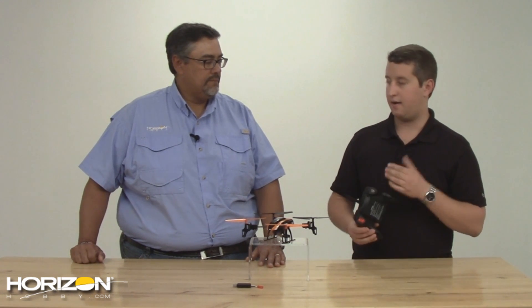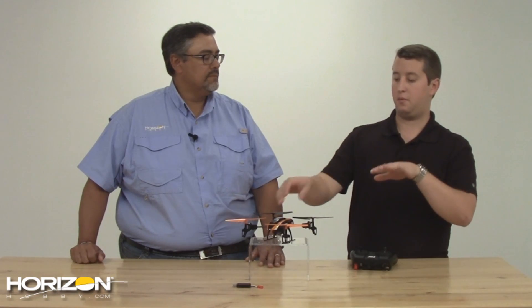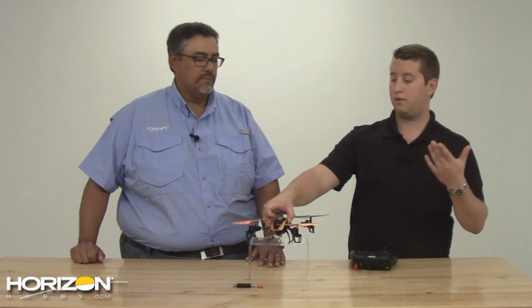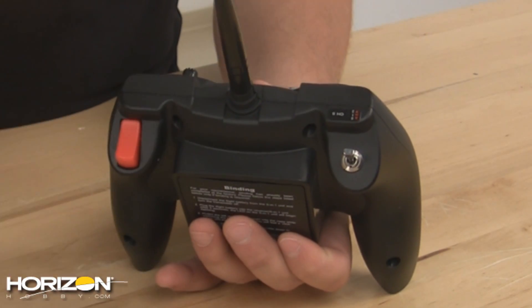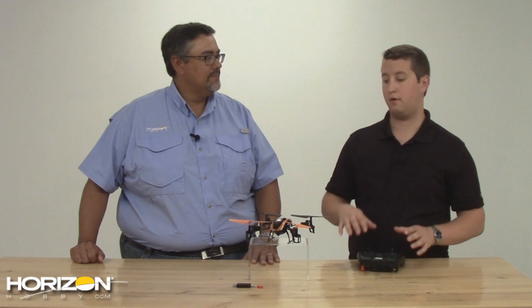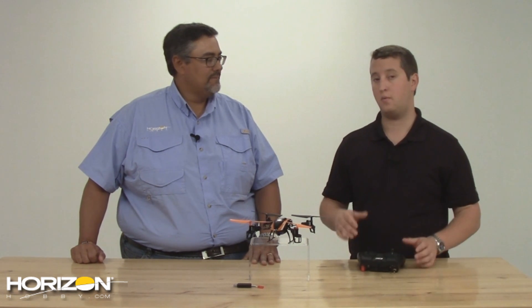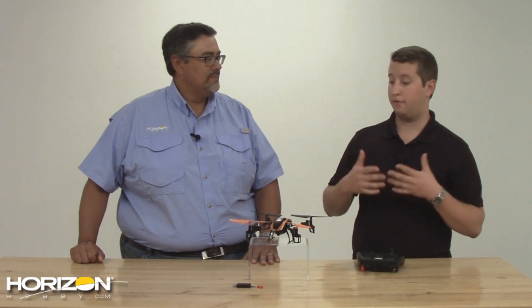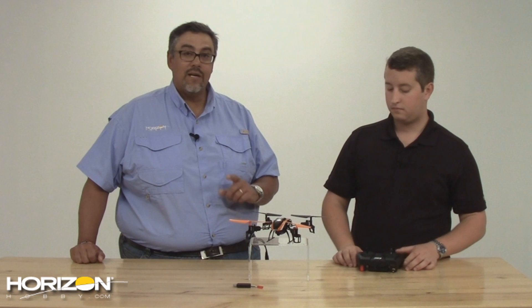The next position is high angle stability mode. That's going to give you less bank limitations, so you'll be able to bank the model much further to do a little more aggressive flight, but it still won't flip over or go upside down. The final mode is agility mode, which gives you zero flight envelope protection, so you're allowed to do flips, rolls, loops, aerobatics. It's also good for the advanced pilot who wants to do precise filming maneuvers. The final mode is not for beginners — or me, probably, for that matter.